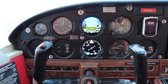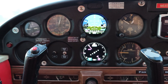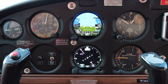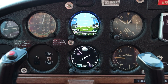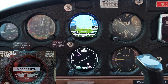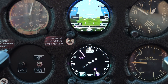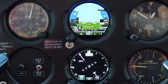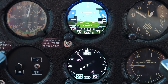Over here on the pilot side of the aircraft, I elected to go with a pair of Garmin GI 275s. I wanted to replace all of the mechanical gyro instruments that were in my aircraft — let's face it, they're noisy and they're prone to failure. In fact, in the lead-up to getting these upgrades done, my turn coordinator failed and had to be disconnected and marked inoperable, and my attitude indicator also failed and had to be replaced with a used unit. So hooray for no more noisy gyros at startup and shutdown, and hooray for no more vacuum system.